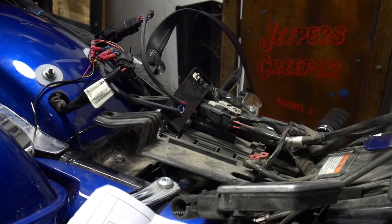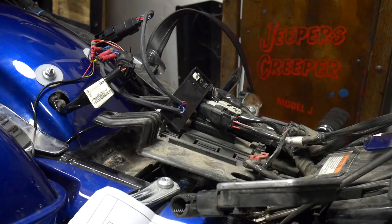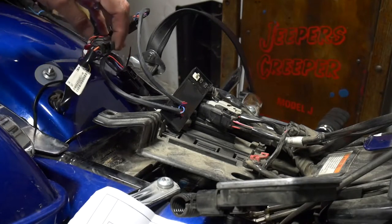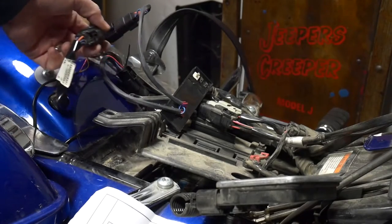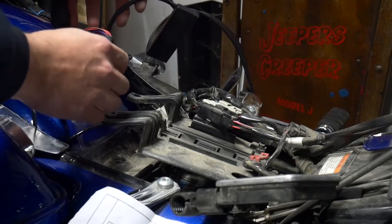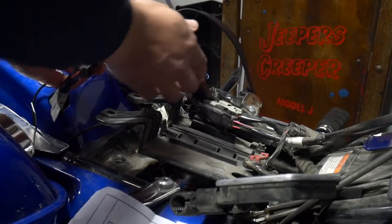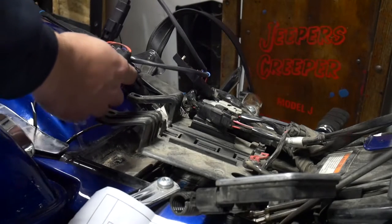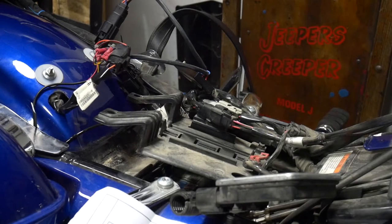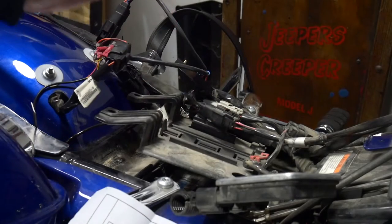I don't know if it's because I already installed the fillers or what the deal is. But I thought - I installed the fillers back here on this harness, so why not just use that one? So that's what I did. I just plugged the magic strobe right into that harness and I put it on the left side of the harness. So it runs through and comes through this way. That gets all of the lights to flash, including the filler panels. So I just used this connector instead of that one, and that did the trick.